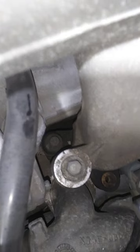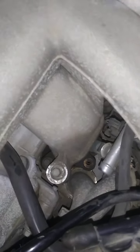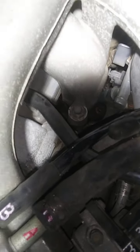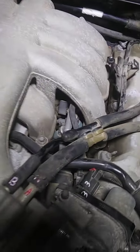And yeah, there you go. I'm gonna snug up that bolt. Maybe I can get lucky. Wouldn't that be neat if I could get that lucky? Alrighty, well, there you go, our smoke trick. Yeah, either intake manifold gaskets and hose clamps on that, and I'll be good to go, or get some new vacuum line from there to there. I'll figure out what that valve is. I'm sure that valve's probably okay, but yeah, there you go.